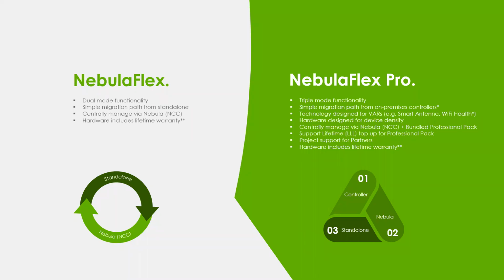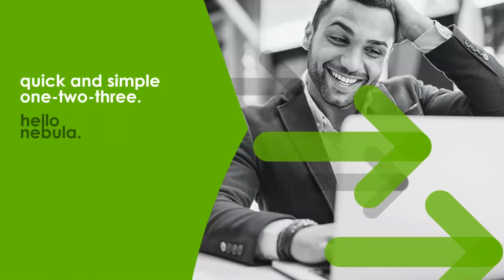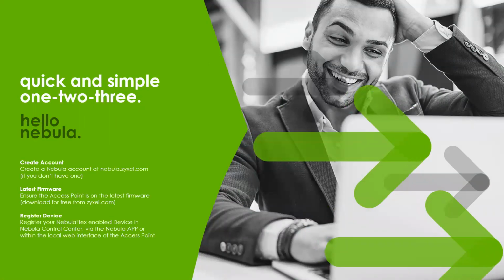If you see Nebula Flex Pro, which right now is just on our access points, tells you two things. It can be used standalone, it can be managed by Nebula, or it can be managed via one of our physical controllers, whether it's a dedicated NXC or whether it's the built-in controller on our USG, ATP, UAG, etc. gateways. It also tells you that it includes 1 year of our professional pack, which we'll talk a little bit more in a few slides here of what that is. But there you go. So if you want to use Nebula mode when you're using a Nebula Flex device, it's super simple and easy to do.